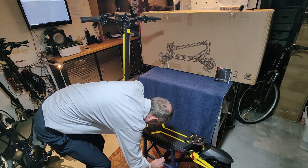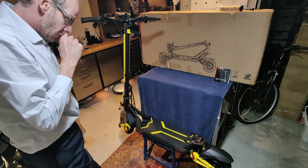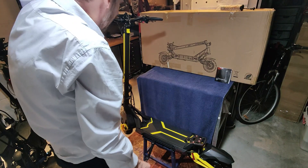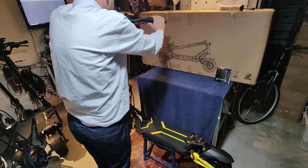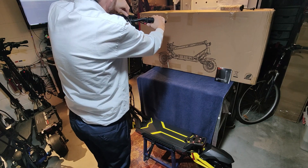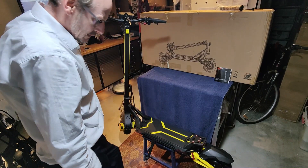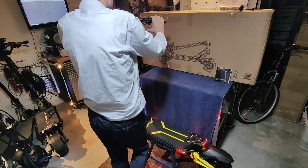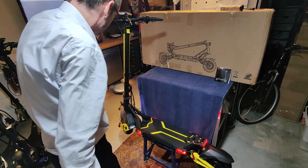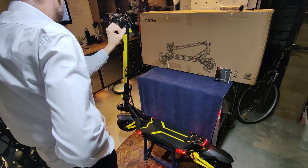The stand is quite nice — thick, heavy stand, as you'd expect on newer generation scooters. There's a single and dual motor button. My recommendation is to always ride dual — just spread the weight and load over the motors and controllers. Always ride dual unless you really don't want front wheel traction on gravel or something like that — though it's best to stay away from gravel anyway.